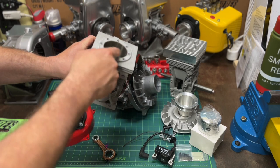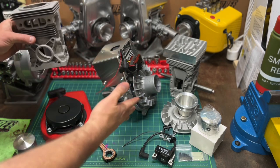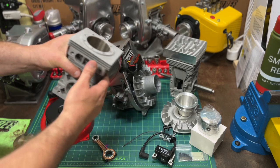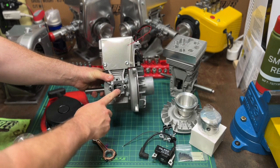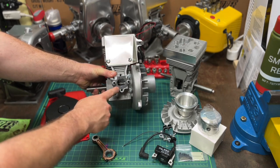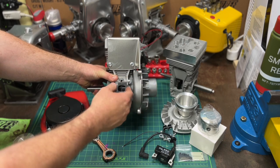In a second we'll go over a couple of differences, but you'll notice no boost ports — no boost ports in this. It's just a regular 820 block. Standard West Bend reed cage with stainless steel reeds — those will last probably all of our lifetimes and not break.